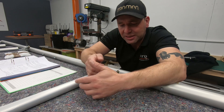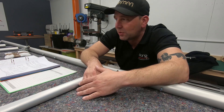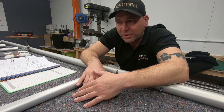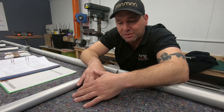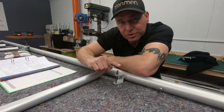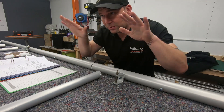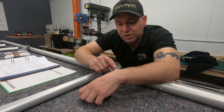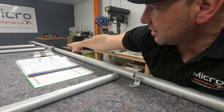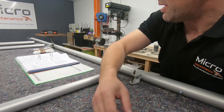As you're working through, you'll notice there are varying bolts that should be in a certain orientation. It's worth having a good look at another SkyRanger in your hangar or getting to grips with why those bolts are there. For example, these ones here are for the jury struts — they'll attach in this orientation. This wing is upside down at this point, with the bottom side up, so the jury struts fit here. Looking down the tube, you can see the main strut brackets are also facing the right way.